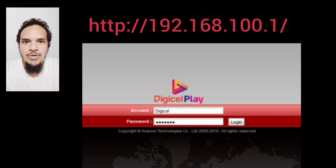On your modem, there is a label that says log on address 192.168.100.1. Go to this address, 192.168.100.1, in your browser.